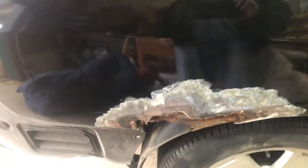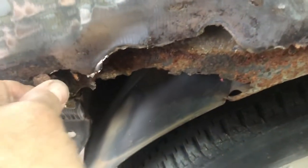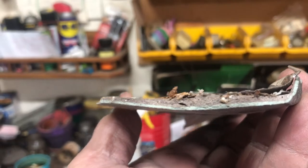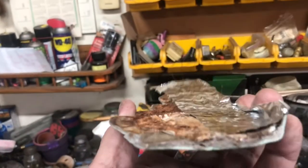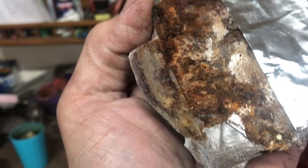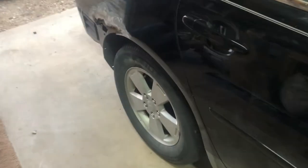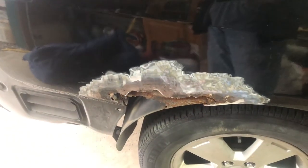This is why I hate people who do shoddy work. There was a ton of bodywork done over here and none of it done correctly. If you see this right here — you know what this is? That's foam rubber, and they used foam rubber as a backing for their bondo. If you look over here, this is how thick the bondo was — that's almost a good quarter of an inch. They backed it up with aluminum tape too. And then this rubbery foam rubber was what was behind the bondo. And of course that didn't work. What a schlock job.